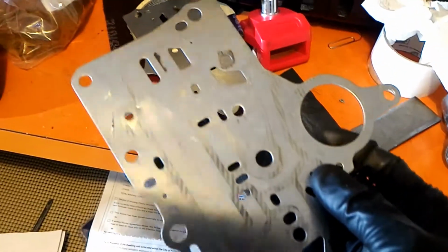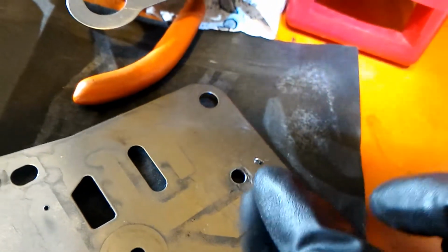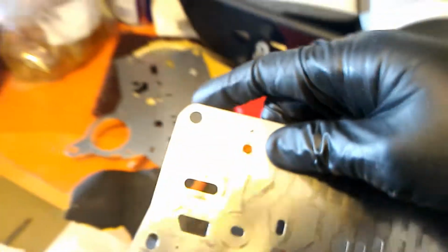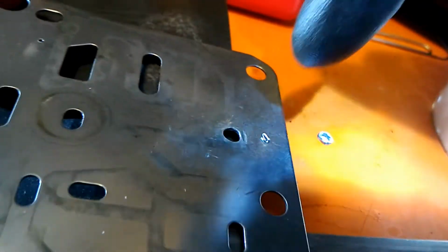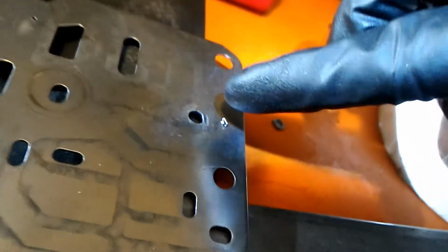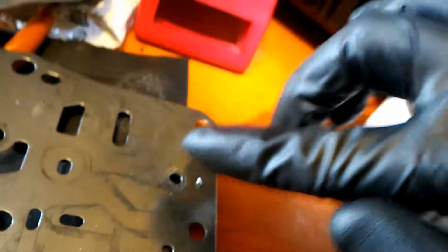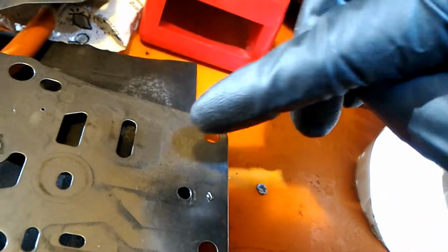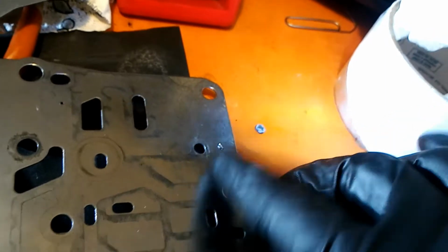So on my first attempt on here, let's see, okay, right here, they didn't tell me in the directions that the plug had to be flush, and so when I bolted it down using the screws on the regulator body, not only did it destroy this, but also it dented the regulator body. So the regulator body could have not actually been flush with this, and so then you got cross contamination between two lines that shouldn't be. So this is trash.